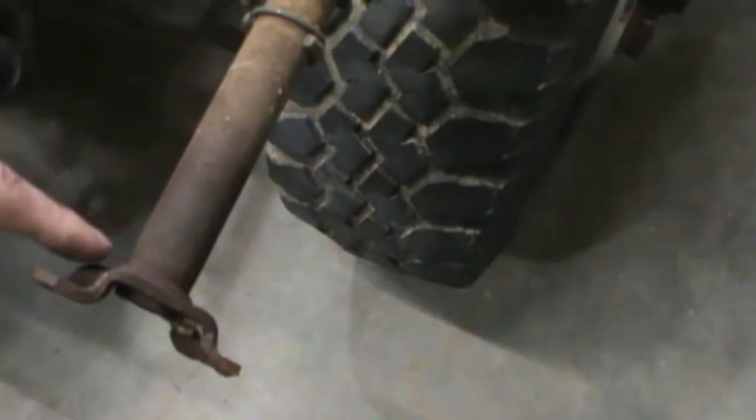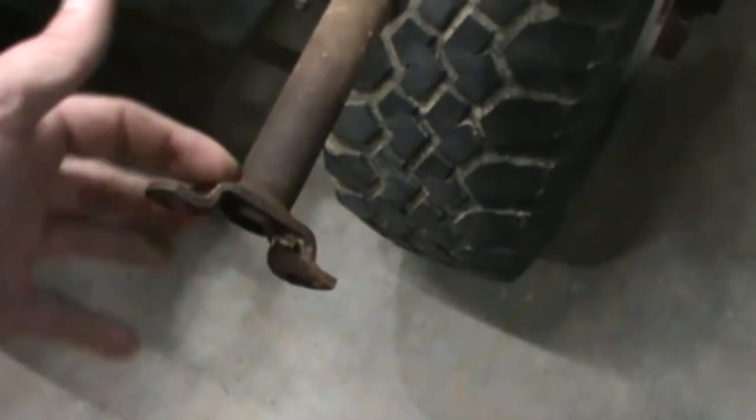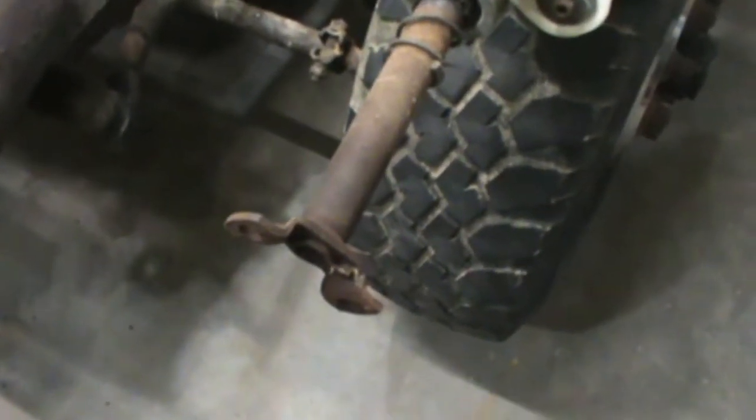and this is something that you'll have to look up on your truck to see if or if not that's an option for you. Now, at least in the '89s, you can see here that this is all one piece. This is welded. So you cannot remove this piece to do away with the rag joint. In your later model trucks, I think it's '92-ish and later, this is actually removable. You can just take this whole piece off, and the updated steering shaft will have splines here, and you can just slide it over there. This doesn't have an option for that. So either A, I'll have to get another steering column, or B, just go back with the rag joint. I haven't really decided what I want to do because it just depends on the cost of the steering column.